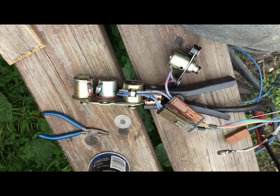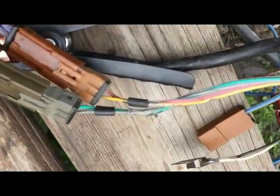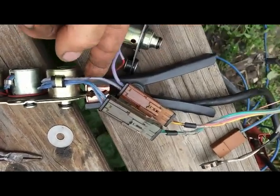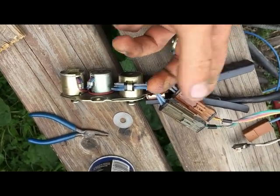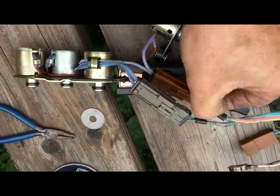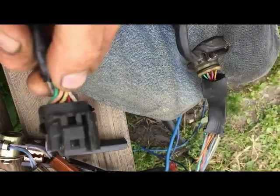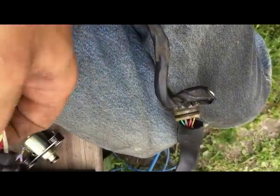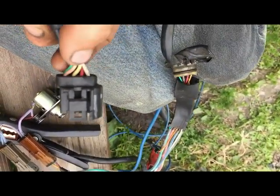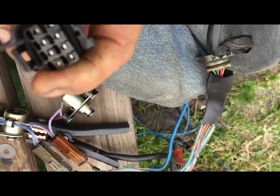To test these things from the outside of the transmission, we're gonna look at our wire and color coding for each one of these. We have gray, green, yellow, and red coming out of these solenoids. Gray, green, and yellow will not give you a click — they'll give you one click and that's it until the hydraulic pressure pushes the solenoid back out. Then our red and blue go to the other solenoid. From the plug we should be able to test continuity between the gray, green, and yellow solenoids to ground, and from red and blue we should hear them cycle.